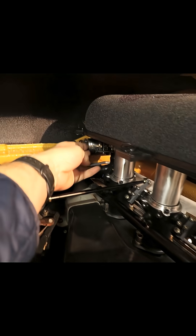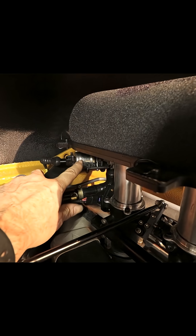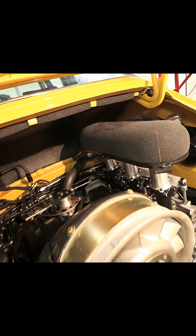One of the nice things about drive-by-wire is that it's good for cold start — it can hold open the throttle bodies when the engine's cold and get just the right amount of air in there. But I have an idle control valve on this engine, and it's tucked away where you can hardly see it, and it does the exact same thing electronically with software. This guy is way smaller than even one servo motor, so it's less cluttered here in the engine bay.